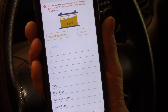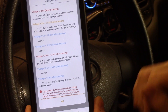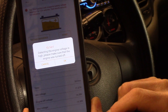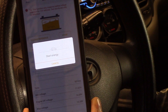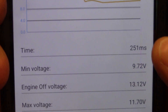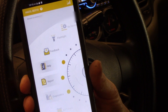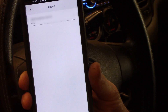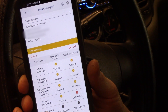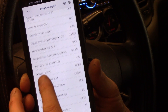Battery check is kind of cool. One of the ways you can check the strength of your battery is just to crank it, or load test the battery, and see if you drop below 9.7 volts. It tells you what kind of voltages are acceptable. It certainly knows the engine is running, so you turn that off and then you crank it and see if it's any good. I've tested the battery on this car a number of times — I'm probably going to be replacing it next year. We're down to 9.72 volts, which is a little bit low, so I'll load test it just to make sure and replace it before it leaves me stranded. It also gives you a bunch of reports saved as a PDF that you can share, download, or email. This is the vehicle inspection one — I didn't go driving, so we've got a lot of unfinished tests because it needs to drive to complete those tests.